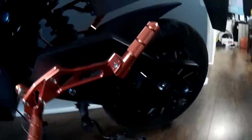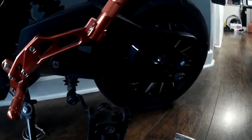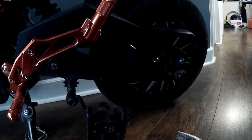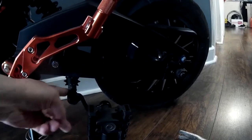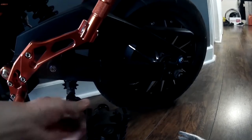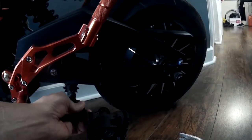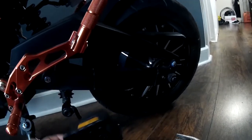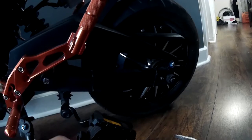What I've been doing is trying to make it better for me. Obviously, I had to shorten the axle because it was sticking out so far, and then I ended up epoxying the rod in there. It still could break loose if I wanted it to, but it keeps them straight so if I take a sharp corner, these don't drag on the ground as much as they were doing before.